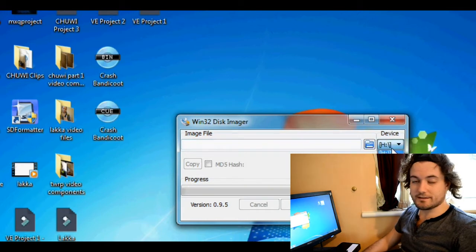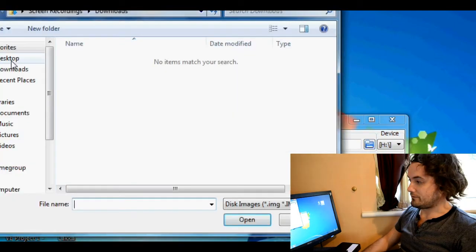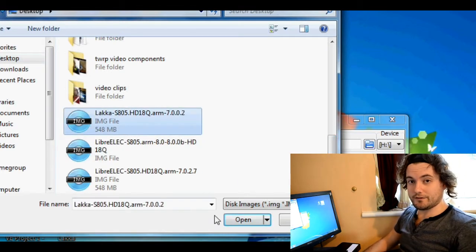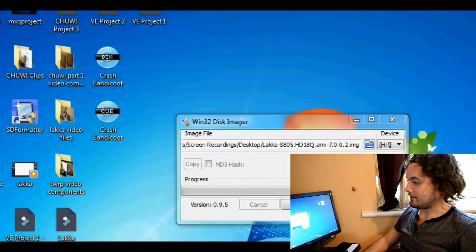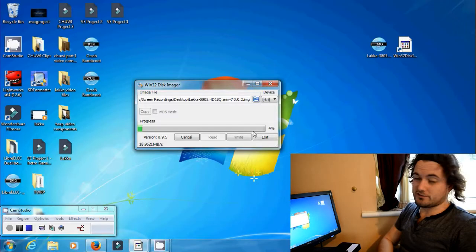Select your SD card, so mine's in drive H, and then you need to select the LAKKA image that you downloaded from the MXQ project. Select it. Remember, if you downloaded the second file, make sure you unzip it first. I'll put an unzip program in the description, if you don't have one. There's a good chance you have. And then all you need to do is select open and then click write and confirm it, and then you can just let it do its job.